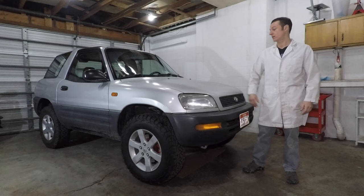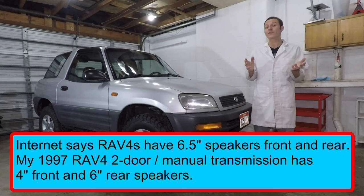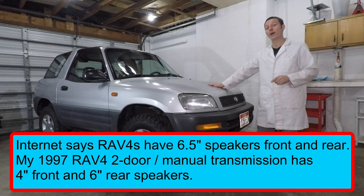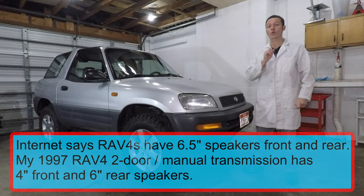Well, that was a lot of work, but with this old turd, it's always like that. I did learn that RAV4s come with different speaker sizes. If you look online, it'll say that you have 6.5-inch speakers front and rear, which is true if you have the automatic transmission with power windows. However, my RAV4 came with 4-inch speakers in the front and 6-inch speakers in the rear. So if you're replacing your stereo, definitely pull those panels off and see what speaker size you have before ordering parts. That's all I have for now, and you'll see me in the next video.